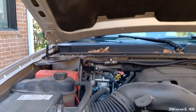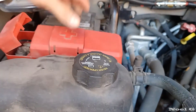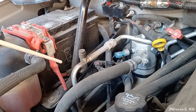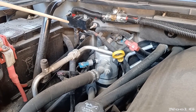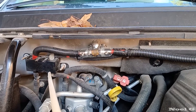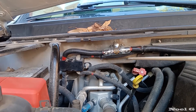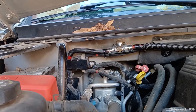I'll go ahead and just start at the battery and go step by step. Here's the positive battery terminal of my vehicle. That flips open, this comes off. To give you a general layout, you can ignore these two terminals — those go to my electrical hookups for my winch in the front and back. This post comes down and has two wires coming off of it. And then you see this one back here is actually going to run back over to this junction over here, which is actually a fuse box. This fuse runs over to this wire, which runs over to the alternator. And then this one goes over to this one down below, which runs over to the main fuse box for the whole vehicle. As far as I know, that was already installed on the vehicle.